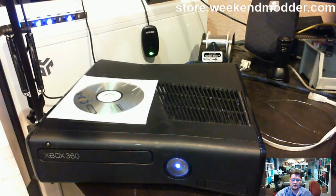So I'm not going to show your CPU key and stuff on screen. I'm going to power it off, and I'm going to power it up one more time just to make sure that E68 goes away. I mean, obviously you saw the first boot into Freestyle, and that E68, feel free to Google it, E68 error message, and then hard drive, and you'll see that it's always hard drive, unfortunately.